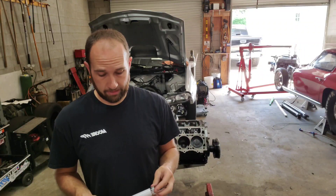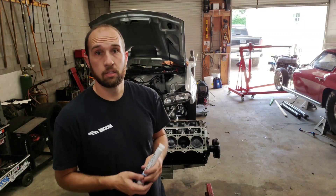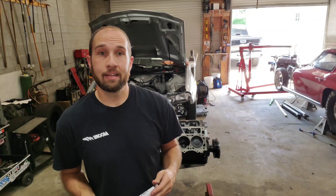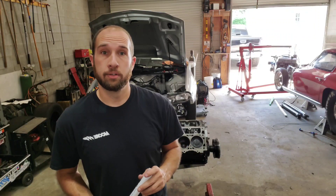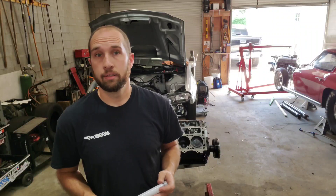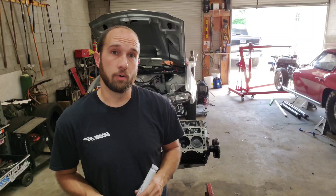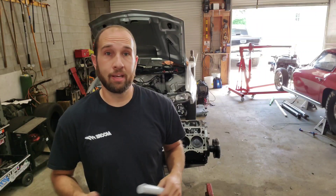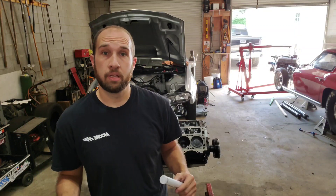I'm doing it because of the issues I've had, but also it's a safety thing. As fast as these cars are getting, having water that can escape outside of the engine and maybe get on the track and get under your tires at 190, 200 miles per hour — you can imagine that wouldn't be good. So the way I'm making this now, it's going to be a complete closed system, and unless a fitting or a hose breaks off, there shouldn't be any water that escapes from the engine.